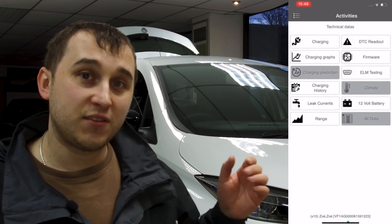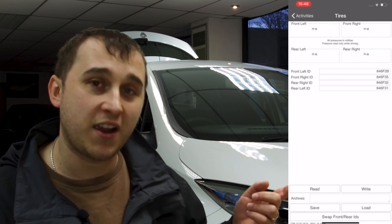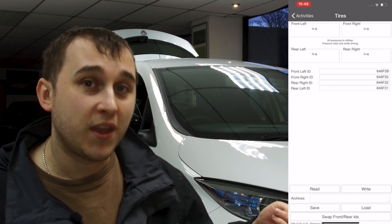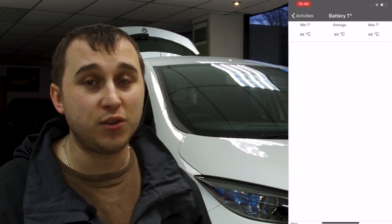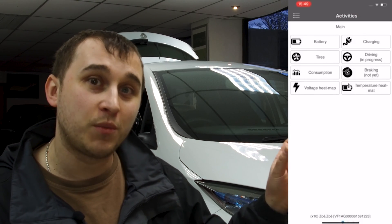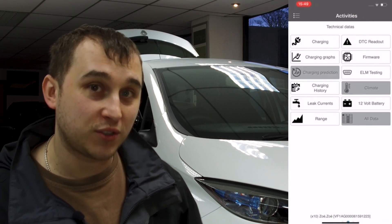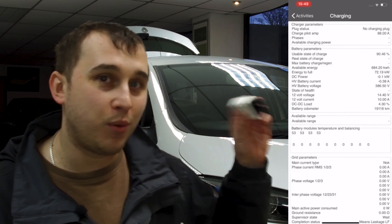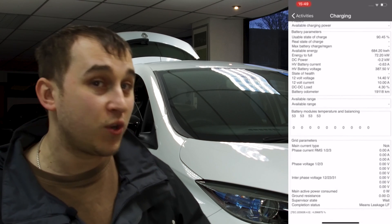With it all plugged in, you can also see the tyre pressure sensors — all the sensor IDs. This is useful if, for example, you want to switch tyres from the front to the back; you can rewrite and swap them. Or if you have a faulty sensor that needs reprogramming and your tyre garage doesn't have the correct tool for the Zoe, you can program your own sensor codes. As long as you've got the hex number, you can program it straight into the car. Unfortunately this feature wasn't working on the beta iOS app I was using, but it supposedly works on the Android app.